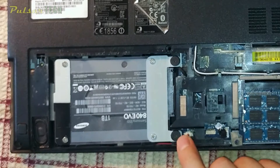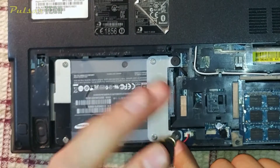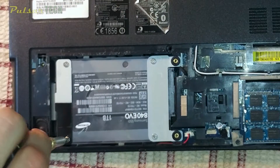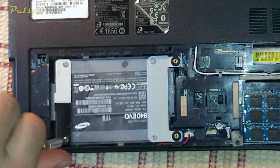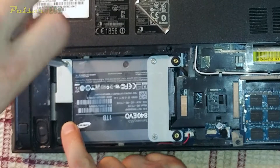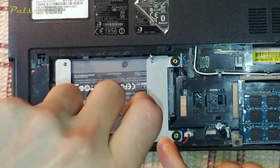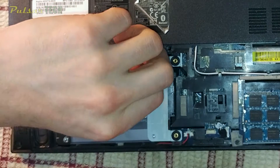As you can see, there are a few screws holding down the hard drive — or SSD in this case — so we have to unscrew those and unplug the hard drive. There are a few more screws on this side as well, and a couple more on the other side too. Those are for the brackets that hold the hard drive in place, so let's take them out.